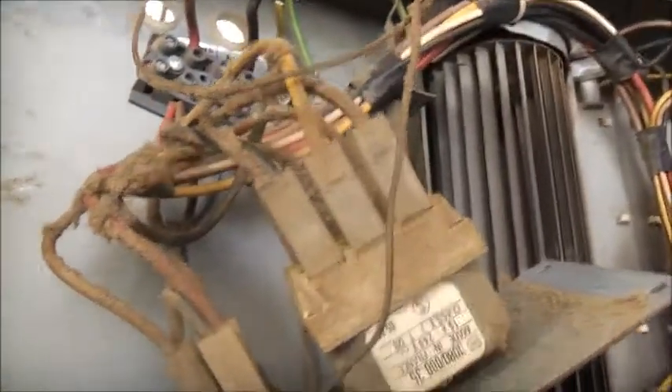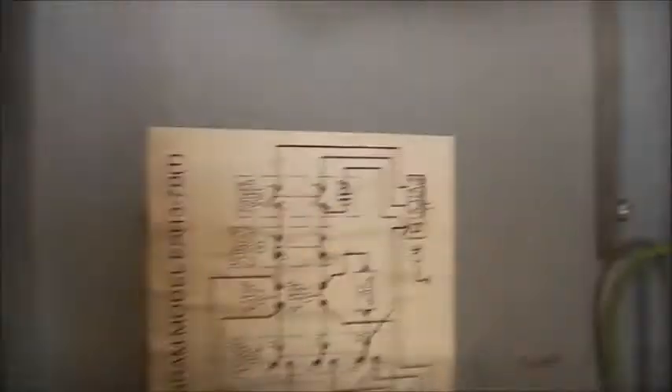I found a date code. The thermostat's made in France - 16A, 240 volt. Date code: 5th month, 1980. So-pack red. Made in 1980, this heater - that's what vintage it is. 3500 watts, 240 volts. That's a standard hot water service heating element there. Silicon spray helped, so I'm going to keep these fans. Keep that, keep everything. And probably just have some fun with these heating elements - yeah, it'd be a good ballast to watch them pop.